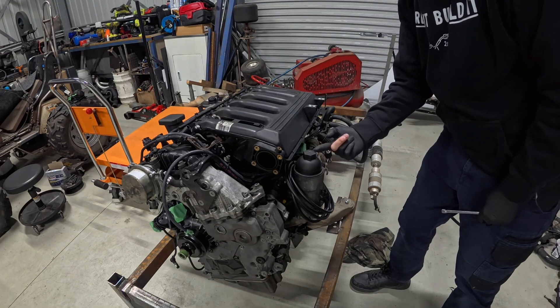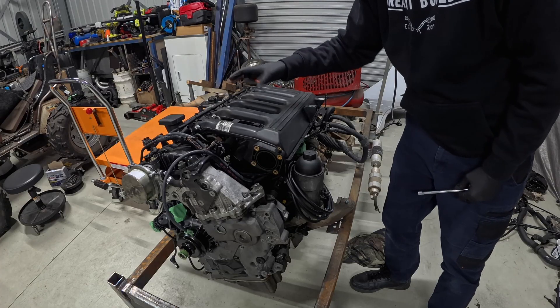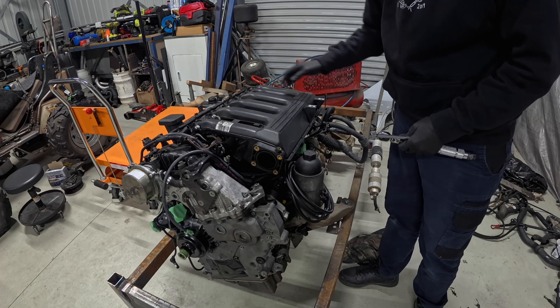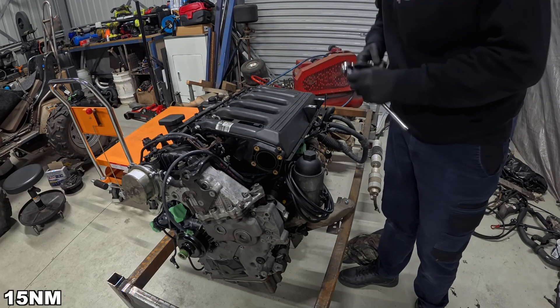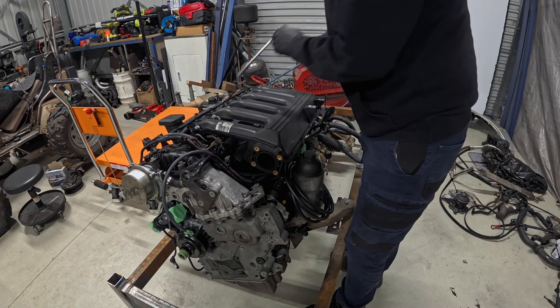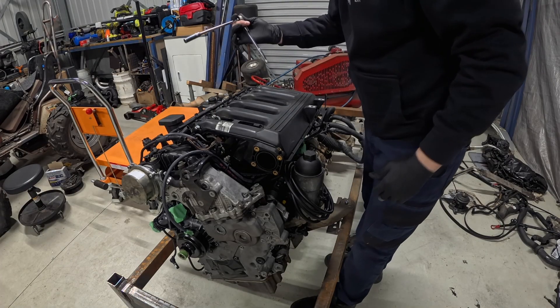Having a good visual inspection underneath and on the top here, making sure our seals haven't fallen out as we've put it down. We're all okay there. Strangely enough these nuts here are 11mm and these bolts at the top are 10mm and we're tightening them all up to 15 newton meters. 15 newton meters feels way too tight for those top ones, so I'm going to go the old school method.